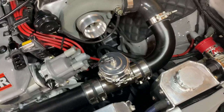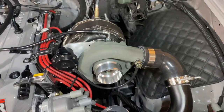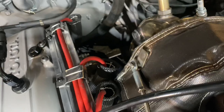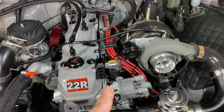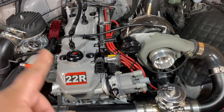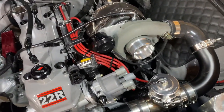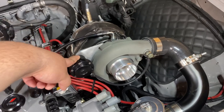The intake piping is from eBay. I've got the knockoff blow-off valve — works pretty good, it's pretty loud, love it. That $100 eBay turbo — love it, works pretty good. It's got 2.5-inch down pipe. The manifold itself is an eBay turbo manifold designed for the stock location, but I ended up chopping the pipes off the flange side and flipping them so the turbo sits up high instead of down low. It looks a lot better. I do have a 2-bar wastegate spring, but max PSI right now is about 22 pounds.